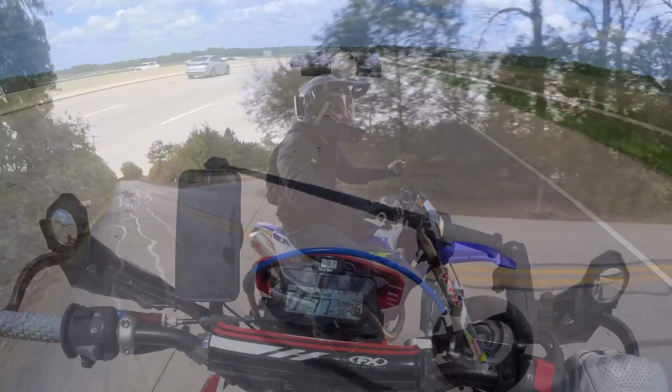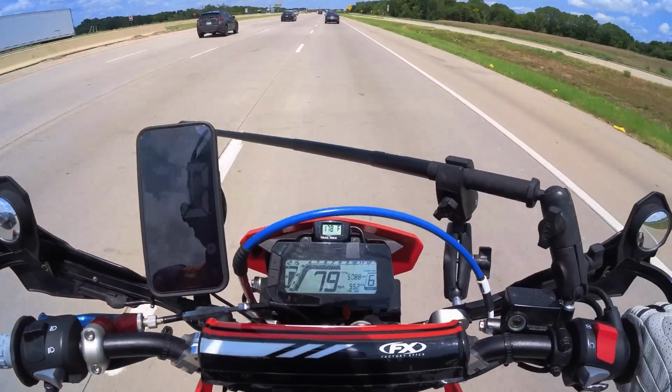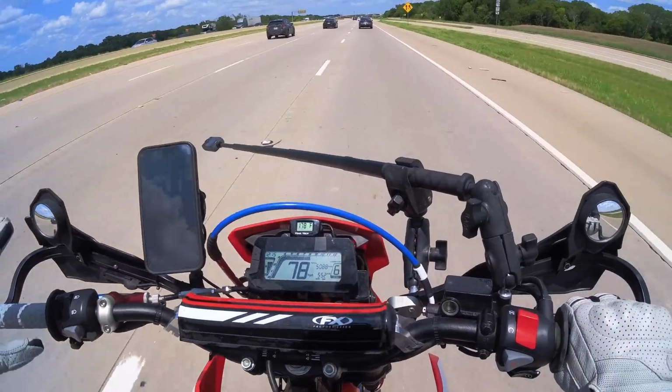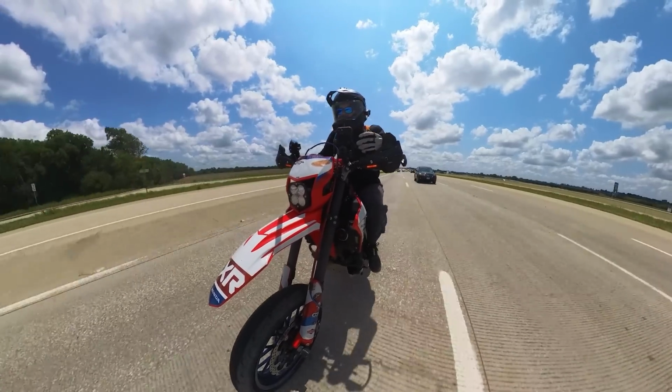And that brings me to another point. Bikes like that 300 spend a lot of time not only in high RPM but really cranked back deep into the throttle. You think of these under-stressed motors as having an easy time, but sometimes you really are dogging them to get them down the road. Never on the Sherco. You're just cruising, you're barely an eighth throttle. But at the end of the day, when the 300L is sitting at higher RPMs and under deeper throttle all the time, which is the higher-strung engine, which is the engine that's being beat on more, it kind of makes you think, right? But this thing does make a lot more power.